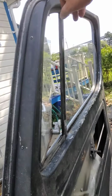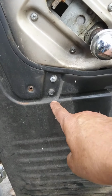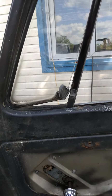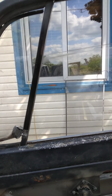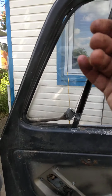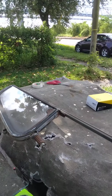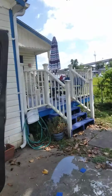the vent window, and there's screws along here, 3 screws like that, and there's 2 screws down here that hold this vent window in place. So when you take that out, you have to spin the window, have the passenger window all the way down. You twist this, the whole frame. Here's one of them. We twist it because there's this lip on it down here, which gets stuck